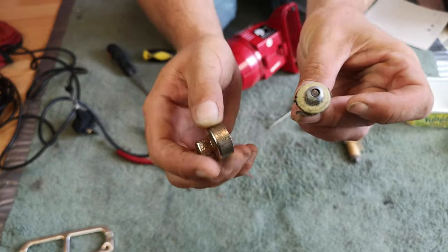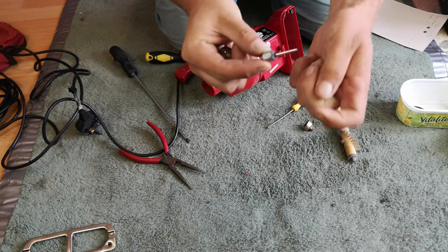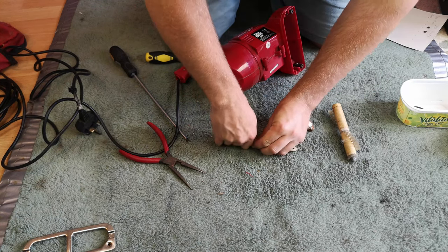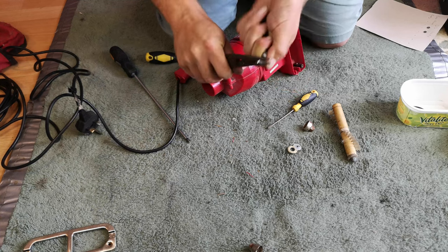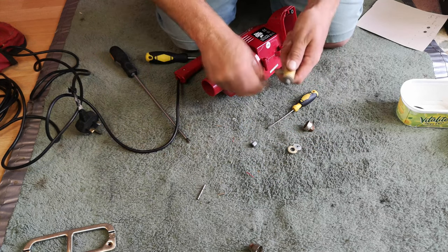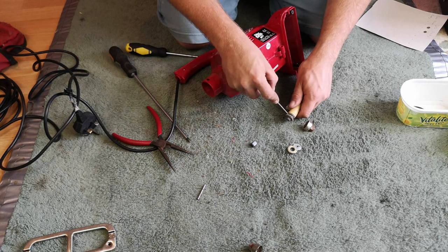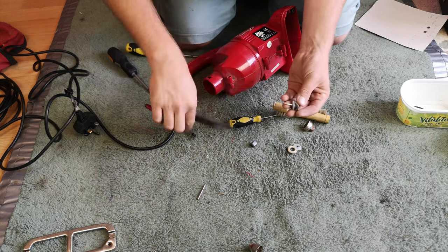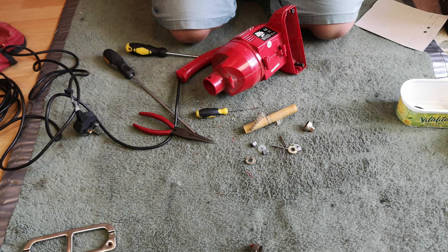This is what they look like - that's the outer part. This locks in; there is a plastic retaining washer, then a felt ring, and then you pull off the dirt build-up. It's very gummed up. Pull off the axle from the brush roll - that will help it rotate a lot better. The other side stayed in so we can gently pry it out. I've just ripped that washer - that was very silly but probably not catastrophic. Sometimes you don't have these anyway.